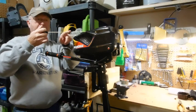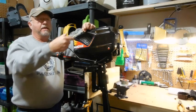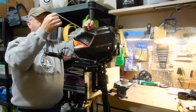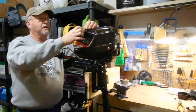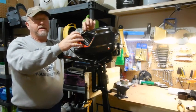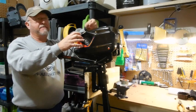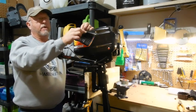Number five, consider applying beeswax to your pull cord. These cords are very thin and not the best material, and I think it'll help it last longer and provide some lubrication. Also, there is a little glitch on the inside of the motor — a guide that tends to come off. What I did to make mine more secure is I wrapped some black electrical tape, cut in half lengthwise, around that guide.